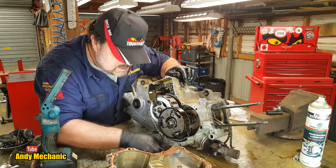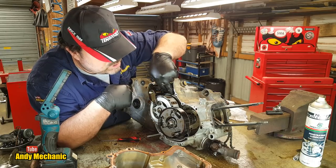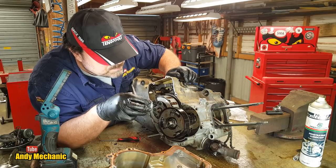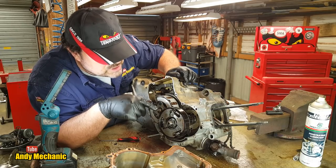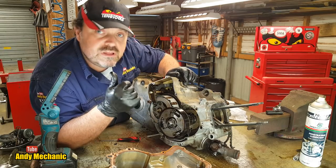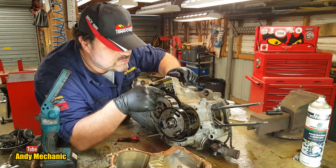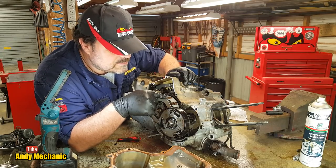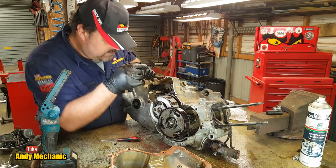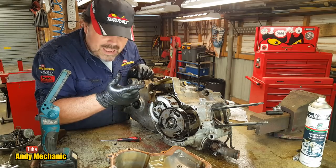We'll come back to that. It has a sleeve which then has a gear down here which then drives your clutch pack. And we'll get to that a bit further down the line. But essentially, when the engine's just idling, there should be no drive into the gearbox. It's only when you give it a bit of a rev that these shoes get thrown out, and then the drive is transmitted through the clutch pack into the gearbox, through all the various multitude of gears in there, and finally out through the final drive to the rear wheels and the front wheels.